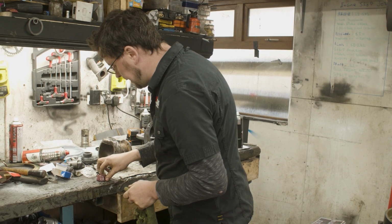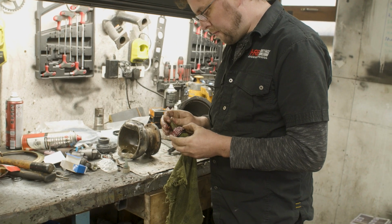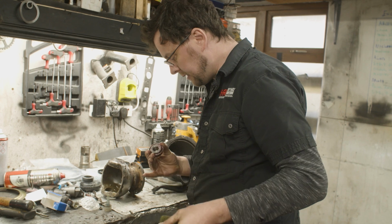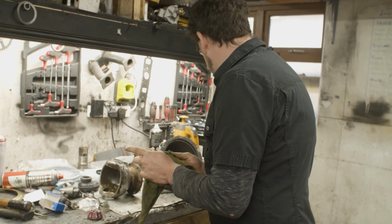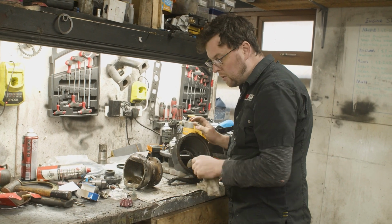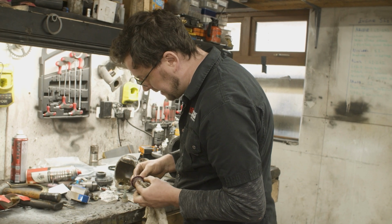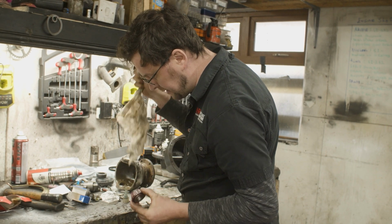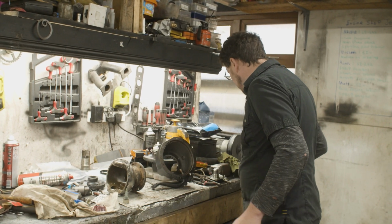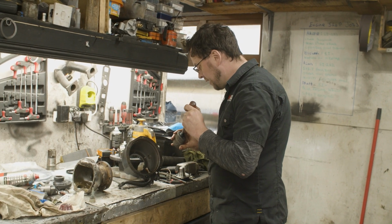Okay, I want to just clean out the center bore of this bearing, because we're going to put a small amount of Loctite, well, bearing fit I suppose, is actually what we're going to put on there, just to help that bearing stay the course. Now, it's not recommended in the user manual, and again, that's serviceability. That's why they're not recommending that.